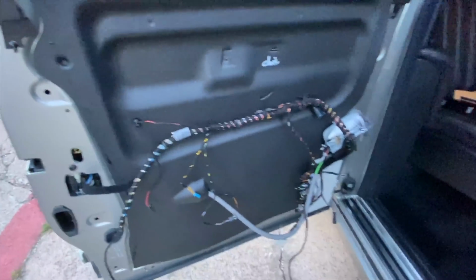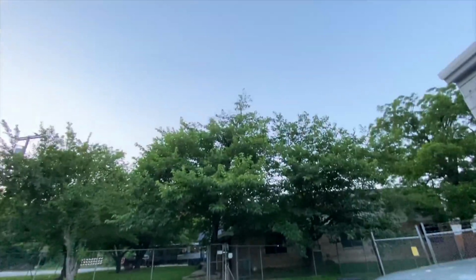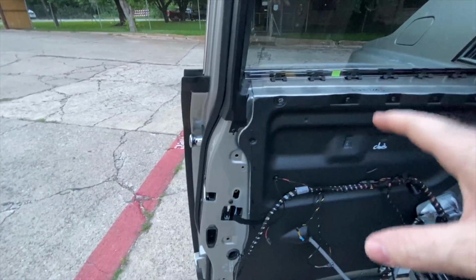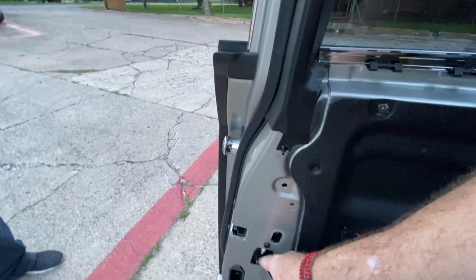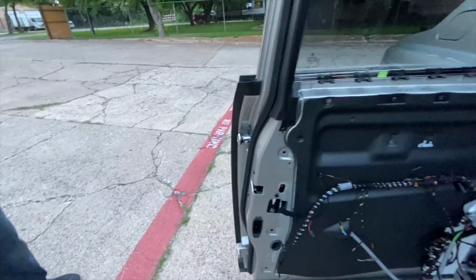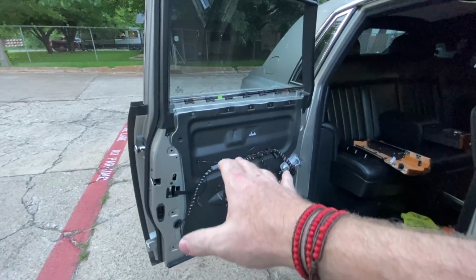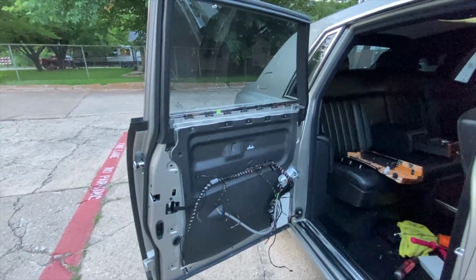So the issue here is this module. The problem is every time I take off, this thing is locking. And it shouldn't do that. Right. There's not an auto lock feature on this car. Like in many cars, at 15 miles an hour, the car locks. This one doesn't do it. The chauffeur has to manually lock the car.